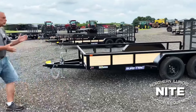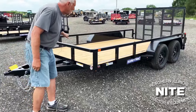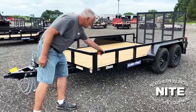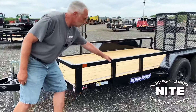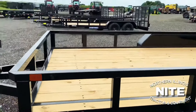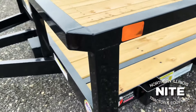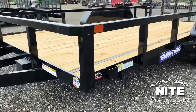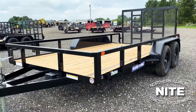This is their tube top version. By tube top, this is a 13-inch high, fully welded railing — 2x2 tube, both uprights and top rail. The framework of the bed is angle iron. So between the angle iron and the fully welded, good heavy tube, you've got a very structurally correct trailer. It will hold up for you and take some abuse.